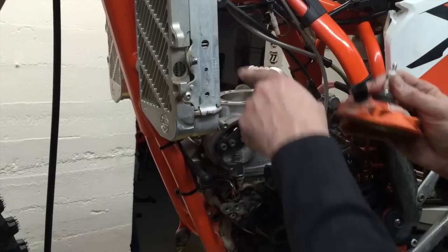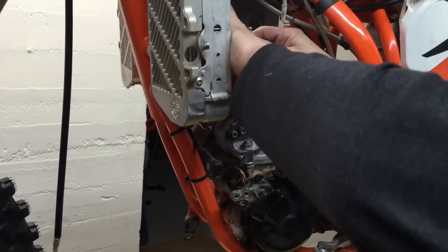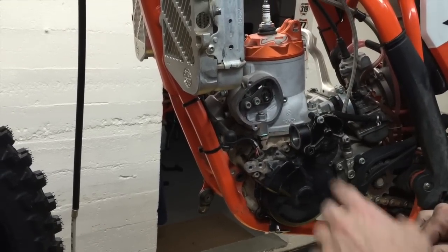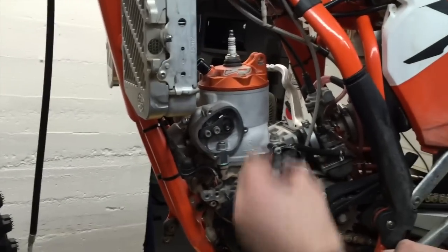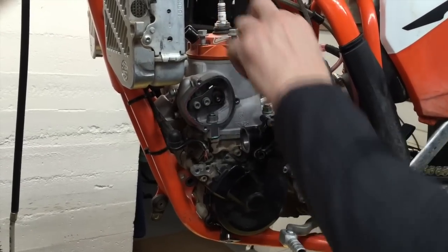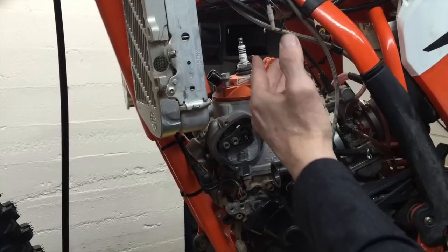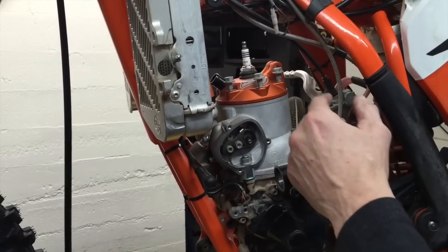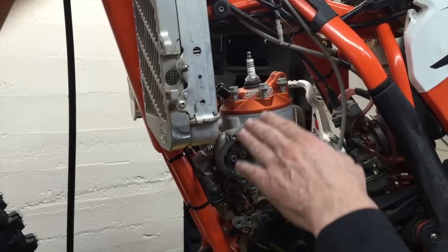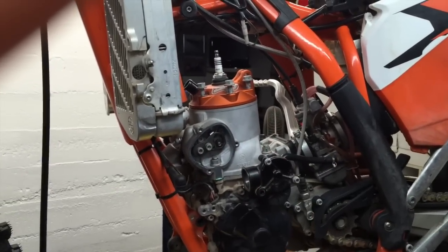So from here, if you've got your locating pins, you can use those to drop the head on. Or if you don't have those pins, you can use the bolts to line it up. So from there, we just backtrack what we did before. And I'm not going to go over all those details. You just put all your bolts on the head. Use an X pattern, just snug them down a little bit with a wrench and snug them down a little bit more. Then get out your torque wrench and bring them up to, say, the setting is 18 foot-pounds. You should bring them up part way, like 10 to 12 foot-pounds on all of them in an X pattern. And then bring it back to 18 foot-pounds.